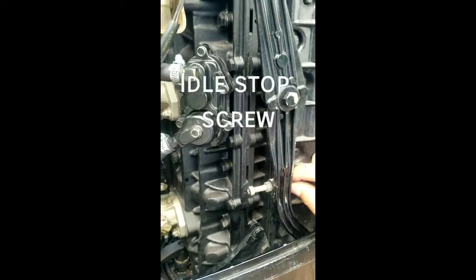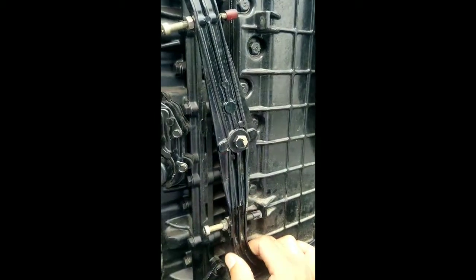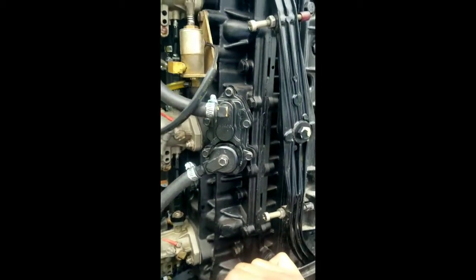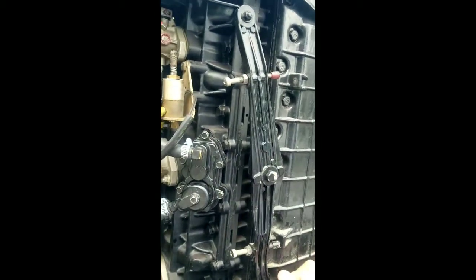So what we're going to do is start at the bottom here. This is the idle stop screw — this is where you set your preliminary idle. I have it set around two degrees before top dead center. The specs say five to seven degrees ATDC, but personally I have never had success with that on an ADI ignition model. You get some back pressure on that prop, some water up in that exhaust, and these engines just don't idle. They just don't have the jet support — the butterflies aren't jetted like they were with the distributor models. But someone can prove me wrong.